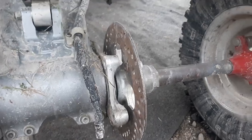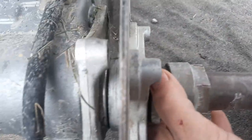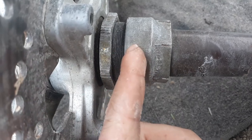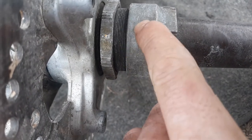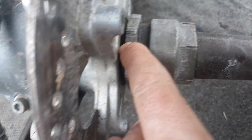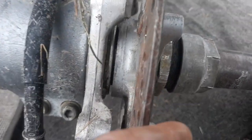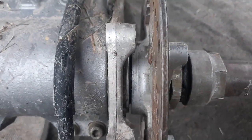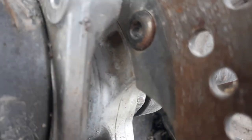You'll see I have the rear caliper off — when I put it back together I have to get this jam nut right here, which is actually loose. I have to put that up against this and then tighten them both to push back this whole threaded spacer, to push back against the whole piece — the brake disc. You can see the gap right there — that's why the caliper won't go on, because the outside brake pad would rub.